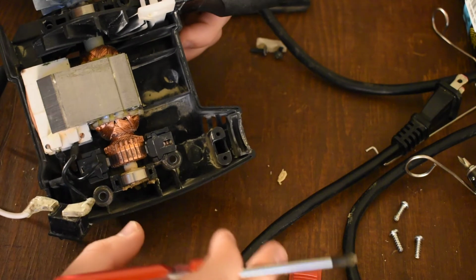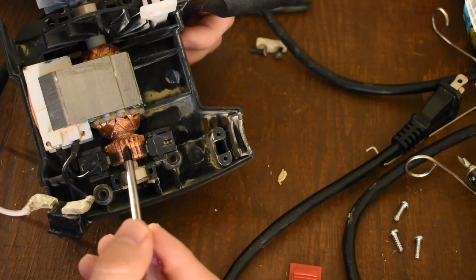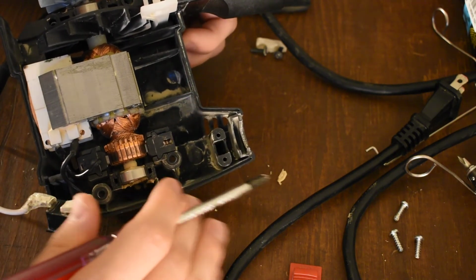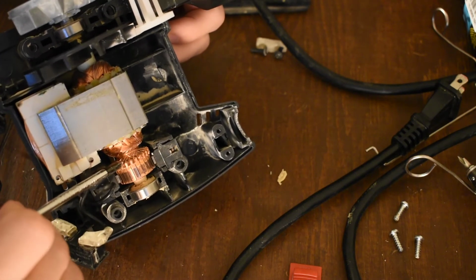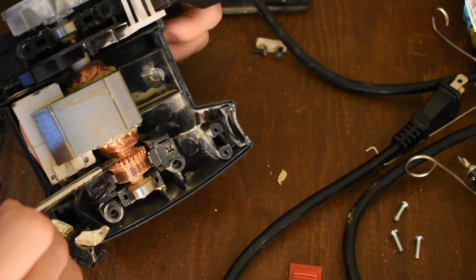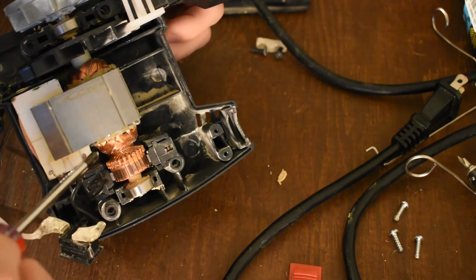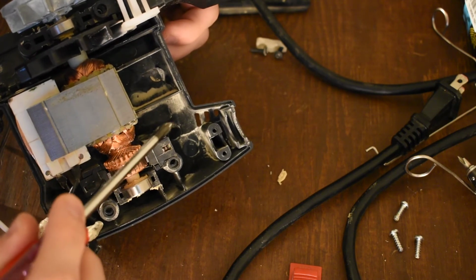So saying there's nothing holding them on is actually sort of a misstatement. They're fixed by these copper bits at the end. That's not the problem. The problem is that there's nothing to prevent this little wire run, right? Where you see the bicycle spoke thing going on here. There's nothing to prevent that wire from flexing. And as the tool spins and it vibrates, these wires will flex. Even if it's a tiny bit.